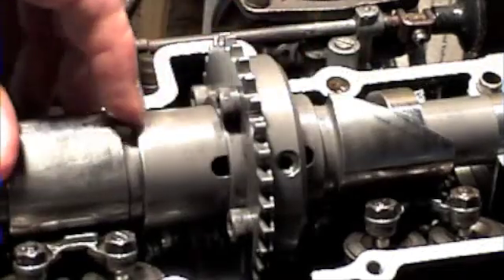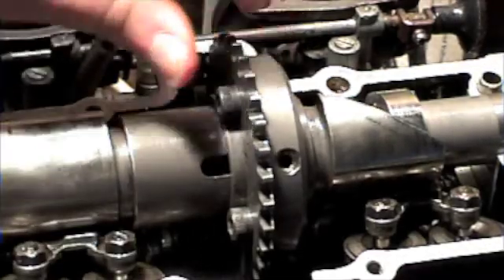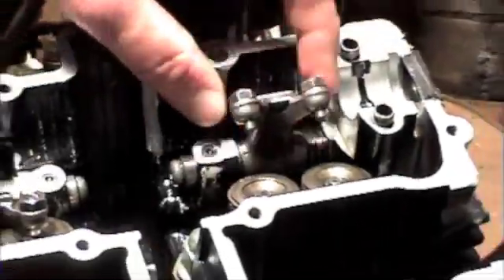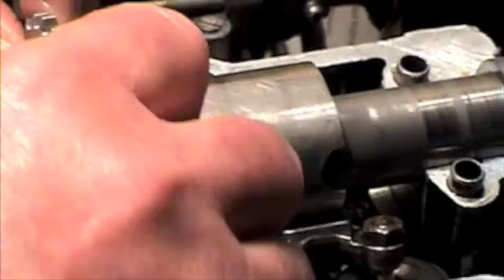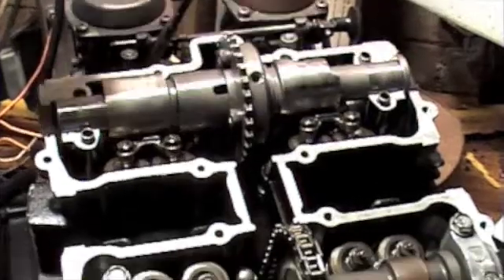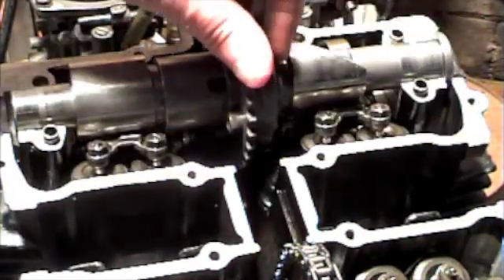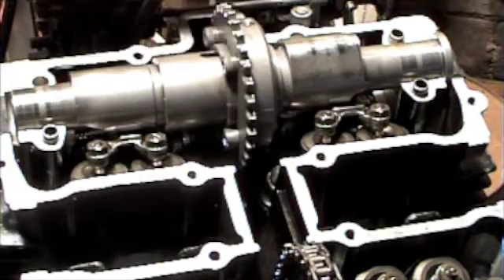Basically this could look very much like a production one. Another point is that it's got two valves, and the one follower operates two valves. You can't really have a separate helical cam lobe for each follower — well, you could actually, but you wouldn't get much range; you'd have to have two of these on each side. But there's nothing wrong with this. The Honda VTEC revs up towards 10,000 and they use a split follower operating two valves, so there's no real disadvantage in it.